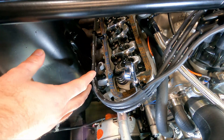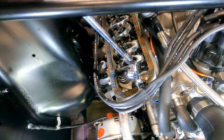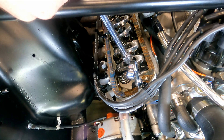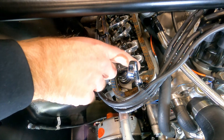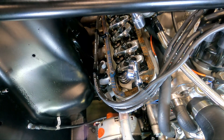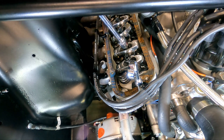Because my motor is in the car it's kind of hard to get in there with a wrench, so I'm going to start at the 12 o'clock position and spin it all the way to nine o'clock. I went all the way around three quarters of a turn, and now that's set — from zero lash to three quarters of a turn past zero. I'm going to do that on all of them. Same thing on this one — go half, and then there's three quarters. Okay, so that's set.